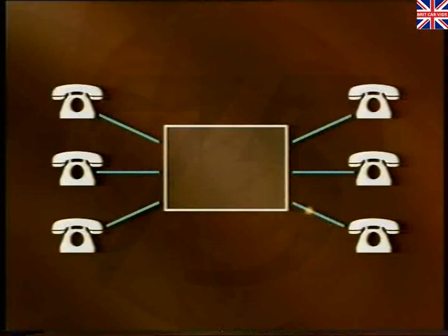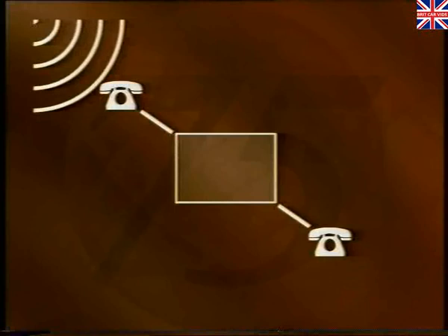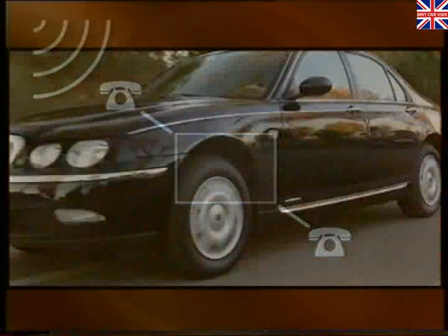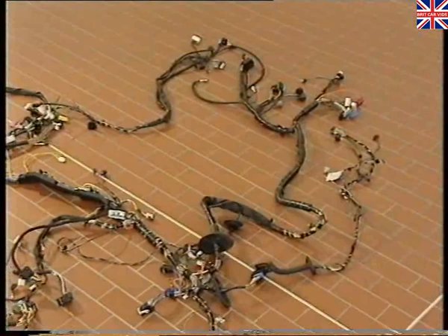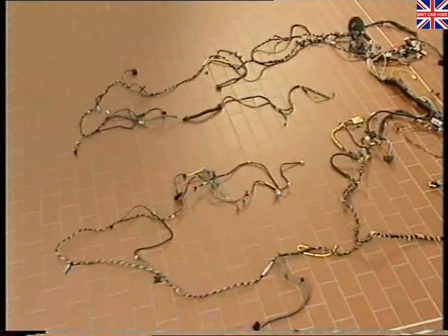With this system, several people can all speak and hear each other, yet the dialogue is passed backwards and forwards along only one or two wires. A telephone converts speech into electrical signals that are passed down wires via a telephone exchange to another phone, where the signal is received and converted back into speech. The system is bi-directional, allowing conversations to flow both ways along the same wires. On the Rover 75, information from a single sensor — for example a wheel speed sensor — can be used to feed many control units, saving on wiring and the number of sensors. So, multiplexing has the advantages of less complex wiring harnesses, which are cheaper to manufacture and lighter in weight, and improved reliability, as there are fewer wires and hence fewer connections.